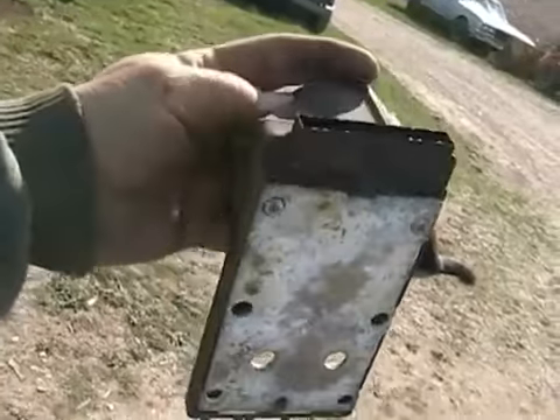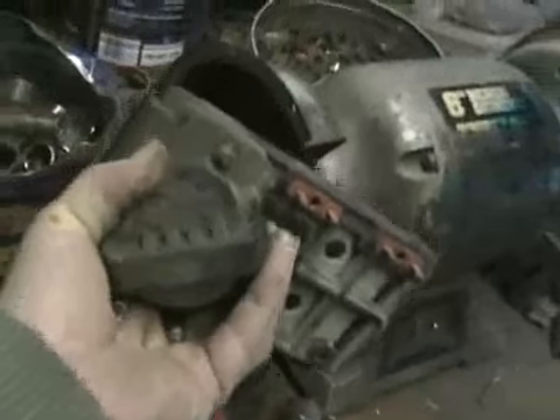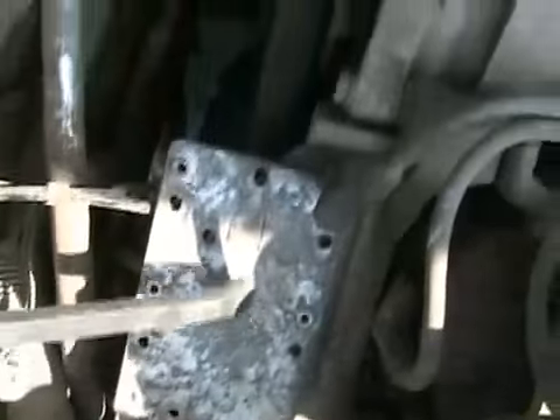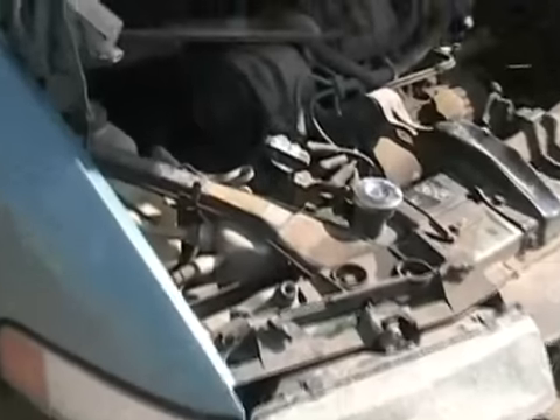There's where your little computer is. Flip on your handy dandy power wire brush and clean it off. Don't that look pretty now? I'm just going to scrape with my little pry bar all that crap off. I hope that's a good enough scratch and scrape job to keep it clean so that it makes a good ground connection with this plate. All back together now.